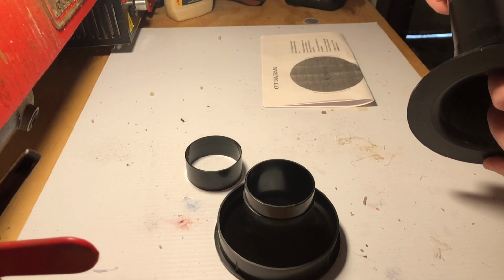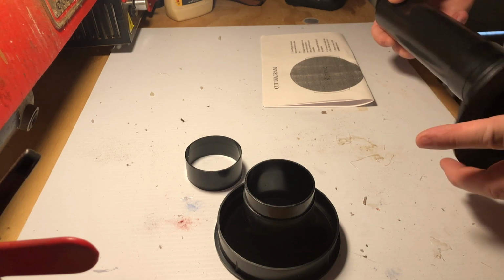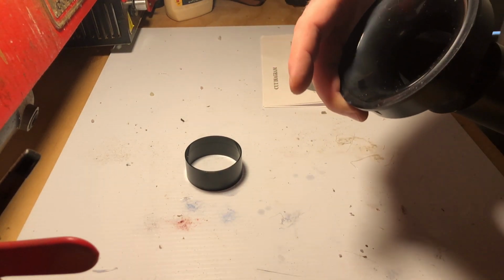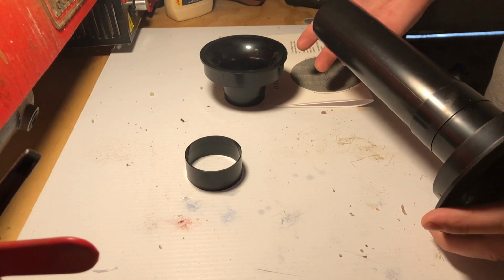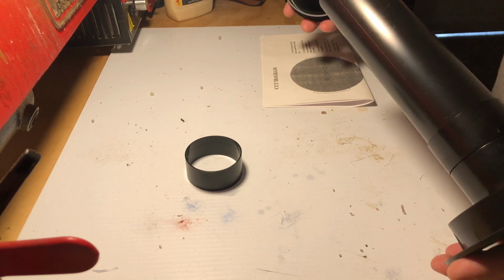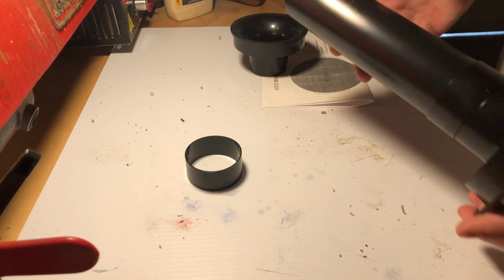The box is 4 6.5-inch subs. I wanted that so I could still have a lot of trunk space and still move a lot of air, so that's what it does. And these are flared inside and out, so I have to cut this down, and the port calculator says 8.5 inches from flare to flare to be tuned for 34 hertz with two of these. So I have to take that number, 8.5 inches, subtract 5 inches from it, and then cut that out of this.